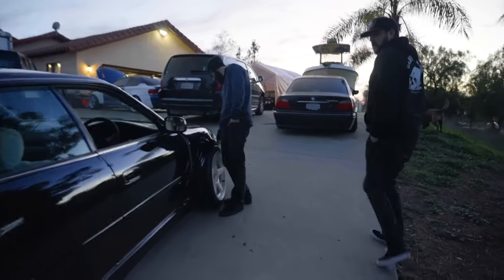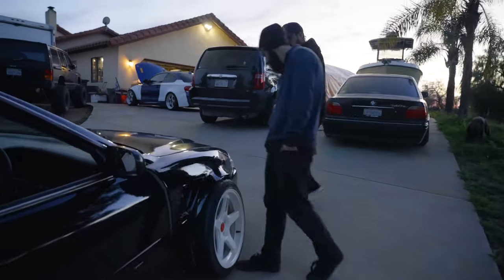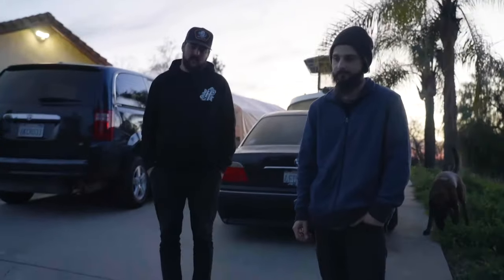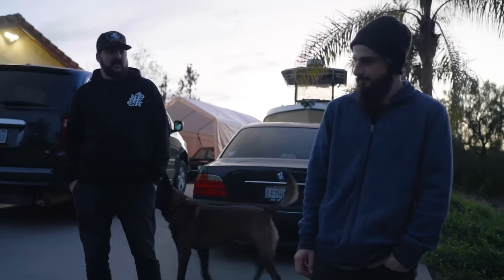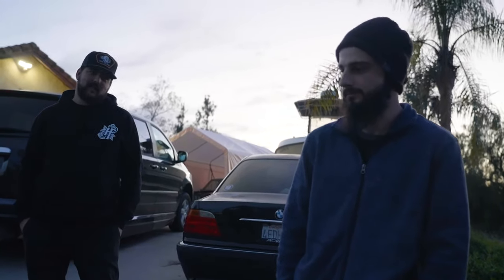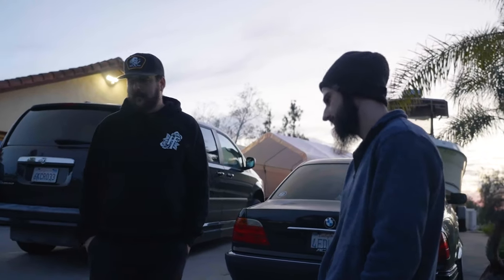It's crazy how these fenders kick in. It looks good though, huh? Yeah. I like that a lot. Now it's just getting it to function. With the 9.5, the tire's still just as tall as a 255. Nothing really changed. You got a little bit of stretch in it, but it's almost identical. So I need to do 10.5 all the way around and then get the rear spacer.